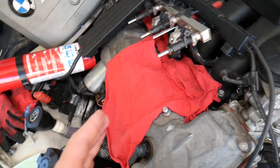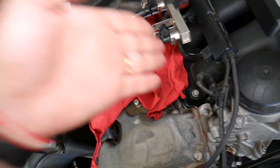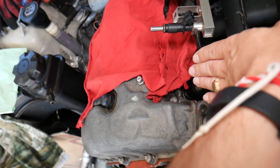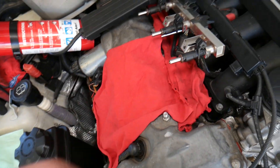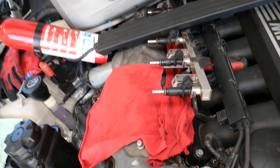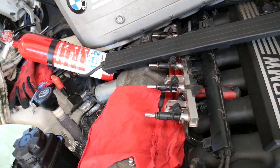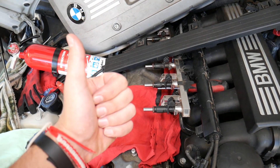You may notice it sprays at a slight angle — that's how it should be on this engine, due to the fact that you mount the fuel injectors on top and they need to point a little bit to the left to get inside the intake valves. So that angle is on purpose. If you need to clean one, we'll have a video on the channel coming soon on how to clean fuel injectors. Hopefully this video was helpful — thank you for watching, and see you guys next time.